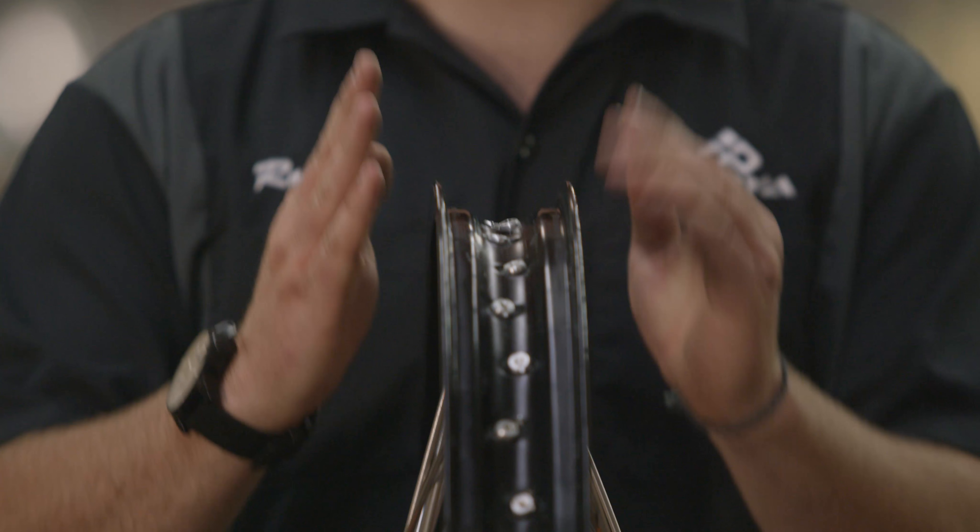The most ideal setup for maintaining a wheel would be using a torque wrench. We highly recommend the Fast Company torque wrench. They have two different options — they have a preset, which is this one. It comes at 48 inch pounds, which is the same torque spec that we build and maintain wheels with here at W. With that, you can get all your various tip sizes. We've got a spline drive tip here, and you can get anything to fit any modern motocross bike.